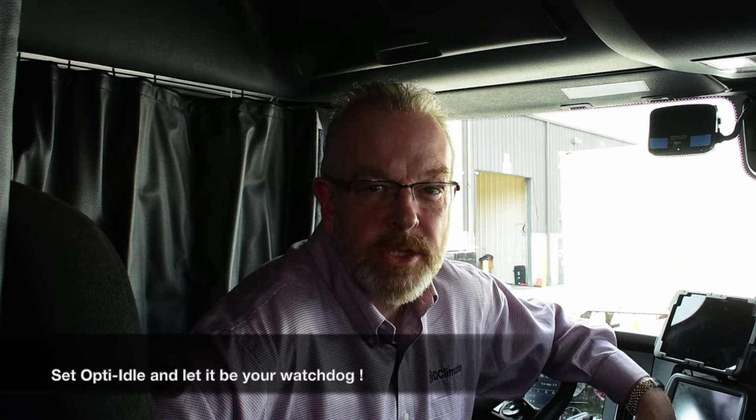So now that we've covered the operation of the DClimate system, there's just a few other items I'd like to cover before we wrap up this training video. The first thing to remember is that it's quite normal for your truck not to start during a rest period. It's not unusual for the batteries never to reach that 11.8 volts. The important thing for you to remember is just set your opti idle and let it be your watchdog.